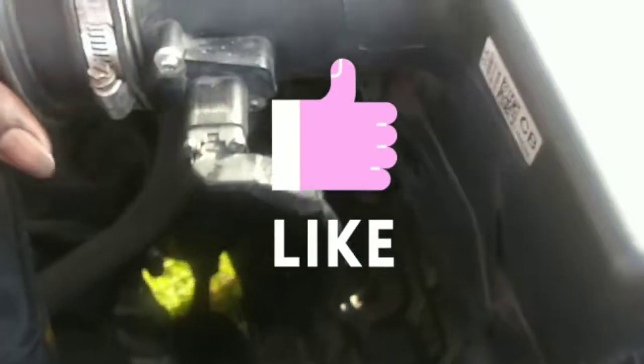Okay, so let's go ahead and bust this steering shaft off and get ready to put the new one on. Also, it'd be easier if you take this intake off. Won't have to worry about it being in your way. So we wedged the bottom, and the bottom's off. You can't see that. There you go. Bottom's off. We're getting the top off. It's already pried apart. We're just gonna knock that thing on out.